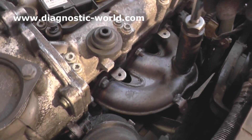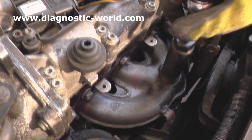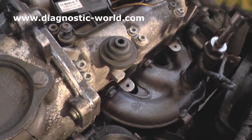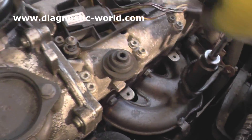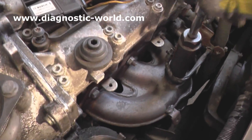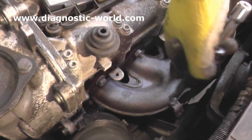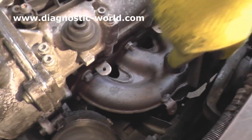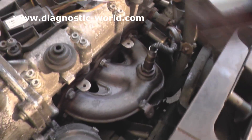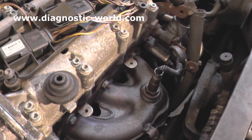It's simple if you've got this tool. If you haven't got this tool, it'll be quite different. You'll need to remove the wiring, bring the wiring back, and keep it away from the actual O2 sensor because, as mentioned, this will get very hot. Once you've done that, tighten everything back up and it's time to get back in the vehicle and clear the fault codes.